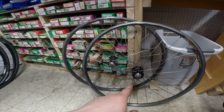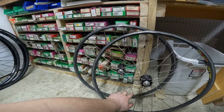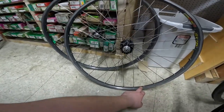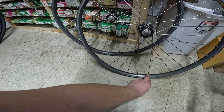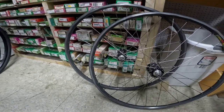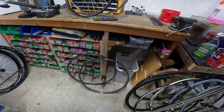I have Chris Kings, but I would need to rebuild the rear because it's got tapered butted spokes and then a bunch of non-butted spokes have been laced in — probably six or seven on the rear. There's already one broken one. The nipples are brittle, and I don't believe there was good spoke prep, or it's just been a long time because all the nipples are super tight and when you do try to turn them they just snap. That'd be an option, but there'd be some work involved. I'm also not the biggest fan of the Chris King buzz — I like a quieter wheel.